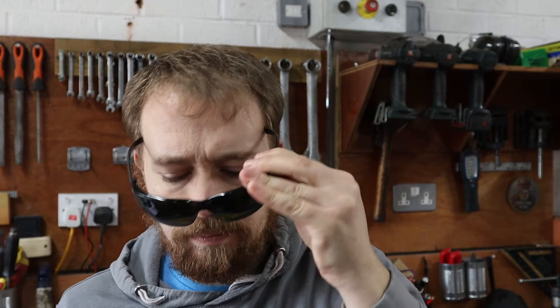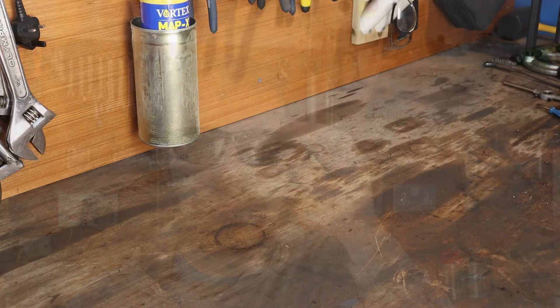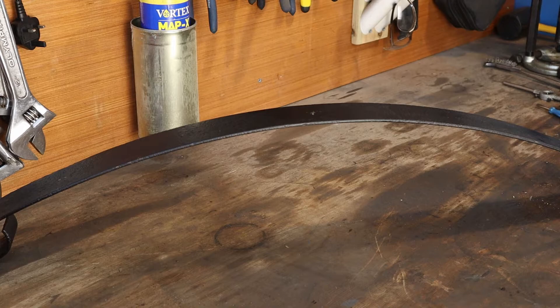Well, I unbuilt these springs a long time ago. Since then I've bought myself a new camera, a new microphone, and a new light. That brings us up to the current day. Also in that time I've shot blasted and wire wheeled all of the leaves. If you haven't seen the video on me building a shot blast cabinet, go and check that out at the end of this video. And I've also given them a coat of zinc primer in black. Now I know that they are going to rub and rust is going to happen, but I couldn't just leave them bare. Right, let's spring into action.